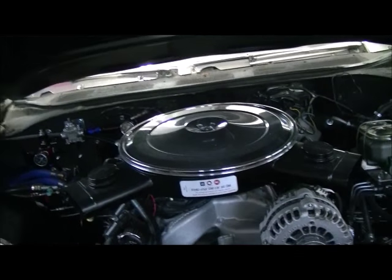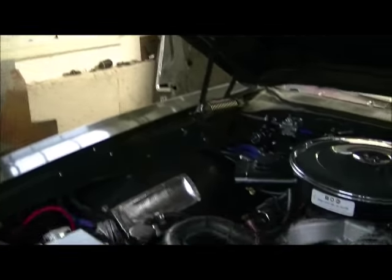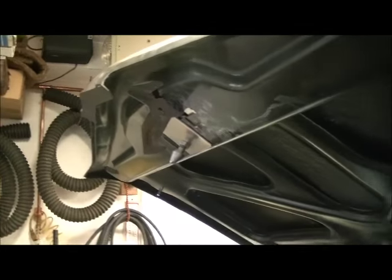Maybe I'll carry the plate all the way over instead of stopping here. If it strikes fiberglass it'll poke a hole, but if it strikes a plate it'll just give it strength. Right now it works — the hood goes on the secondary latch first, then catches the primary latch and it's latched. It's not going anywhere. When you pull the release, the hood doesn't pop up dramatically but you can catch it and pull it to the secondary. I guess you can leave the spring out. With the original latch pin, secondary latch, and hood pins, that should lock this sucker down good.